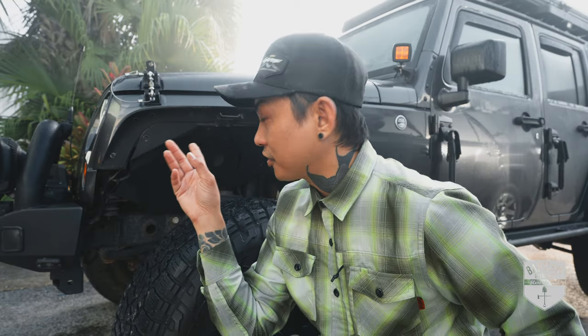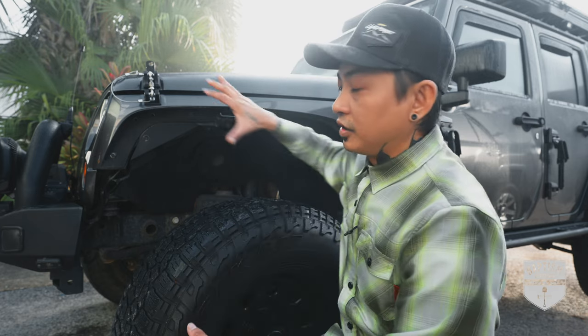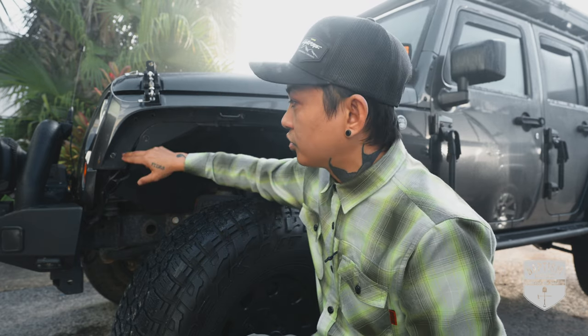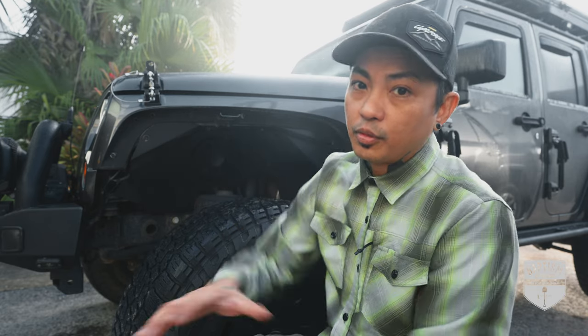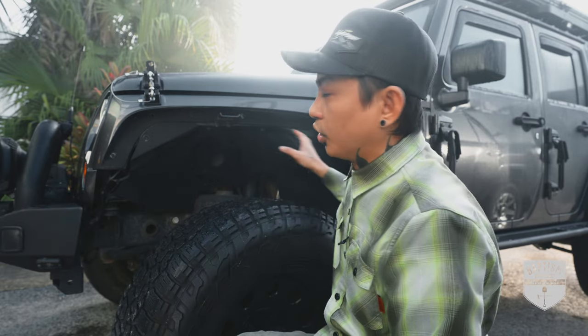The good news is that when I installed these fenders, I had the foresight of knowing I would probably be switching them out later. The thing with fenders is that when you replace your stock fenders with aftermarket ones, these aftermarket companies give you ways of securing the new fender pretty much permanently — whether that's rivnuts or some other means. The problem is not every fender company uses the exact same mounting holes. So if you put a fender on and you start putting permanent rivnuts everywhere and the new company doesn't use the same mounting holes, you're kind of screwed. So I used regular bolts so this can just come right off and all the holes will still be stock.